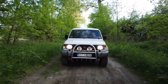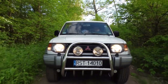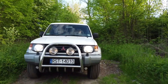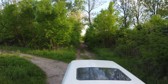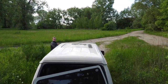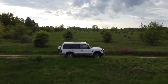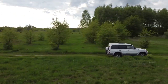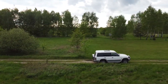Now we have one advantage, which is saving your battery life, and one disadvantage, which is that your car is not protected by the internal locks, so you cannot leave anything valuable inside, or you need to put it inside a garage. There is another advantage, which is safety if something happens, for example, with water, and you need to quickly remove the battery from your car. So you open the hood, turn off the switch, and you are very safe. Another disadvantage that you need to be aware of is that when you disconnect the power, the equipment in your car, like radio and clock, will reset. So you need to set the time and date again in your radio or clock.